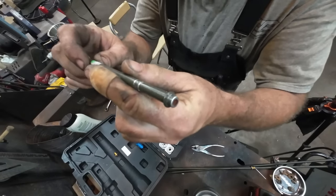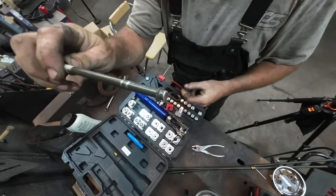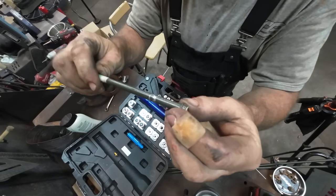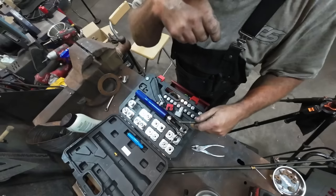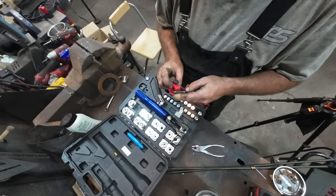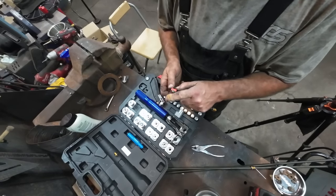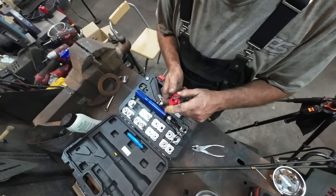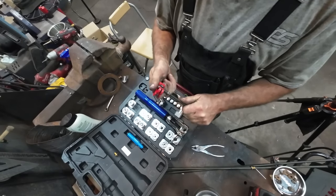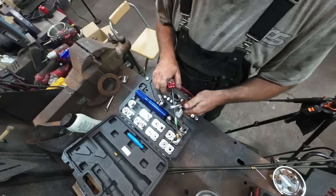I mean, that's a nice flare. For me, I want this style just so I can push the hose on, but I did it like the fuel connect. It's a little too tight. I'm gonna try to make it again, but just with a little less pizzazz to it. I feel happy the darn tool actually works for a change. Every time I try, it's a power steering line and the steel, I guess, is like stainless or something. Well, it's probably not stainless, but it sure acts like it is.